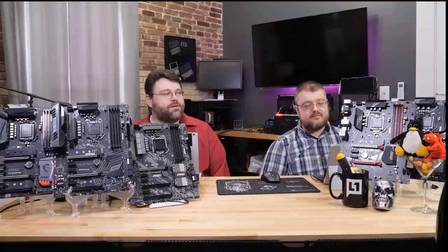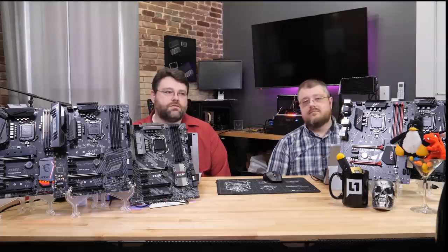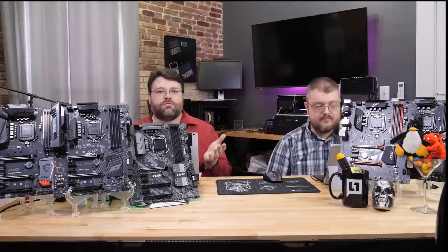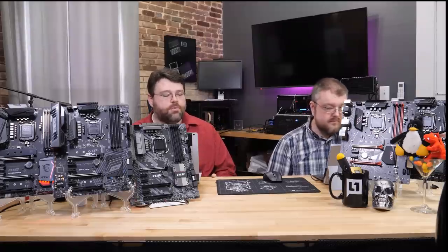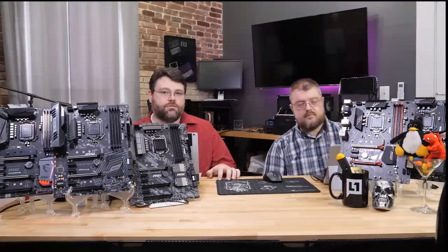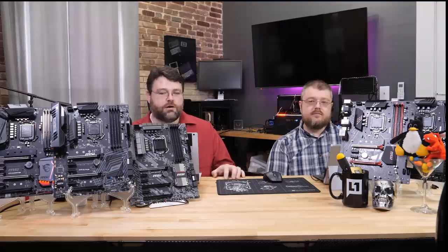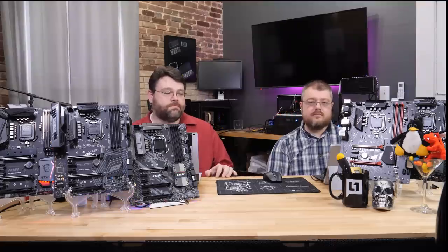So you may be thinking, okay, 6 cores, all 6 cores are created equal. I would rather have the 6 core on this platform than the 6 core on X299, and the reason for that is the lower latency of the platform. Internally, we did a video last week or the week before looking at Sandy Bridge, which is ancient, 5 years old. But internally in the CPU, it's got a very large cache, and it also has a dual ring bus design. The new i7s on X299 use a mesh type design, and so that's why we saw performance regressions in certain types of workloads, mostly related to gaming, between the i9, the new X299 platform, and the previous platforms.